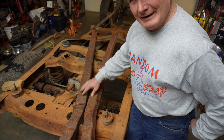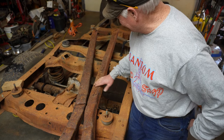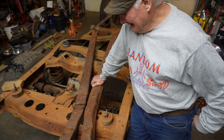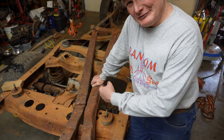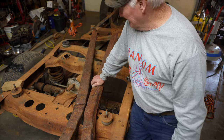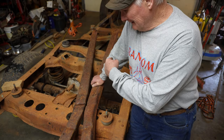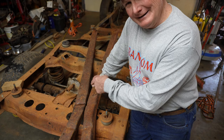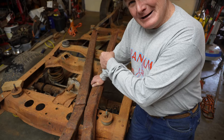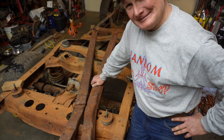It's amazing. I've got some of these that this is actually rusted. It's rusted in two, so there's holes in this thing. Anyway, that's just trivia for today. If you're doing old Chevys, take a look at the trailing arms. The aftermarket makes these out of box tubing, and the truth is, the trailing arms under this that I've got under here, they're not any better than these. So I'm gonna try my hand at making a set of trailing arms, and we'll see how that works out. Stay tuned at a later date.